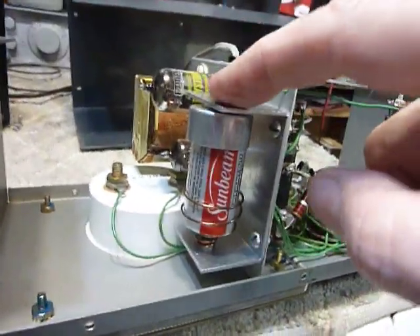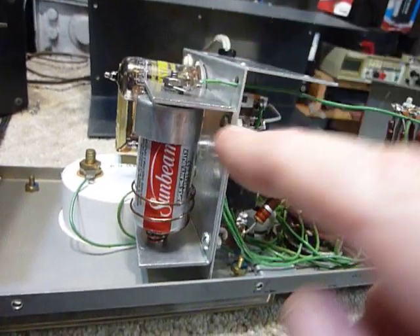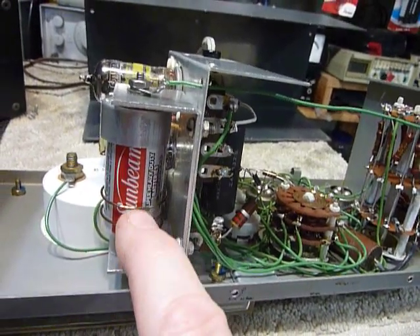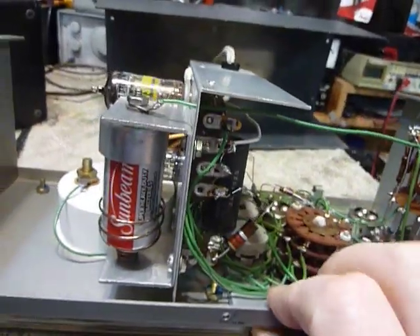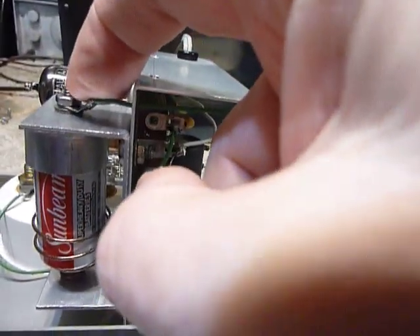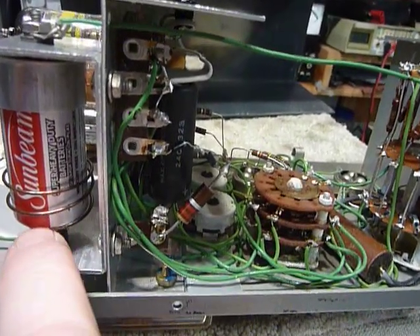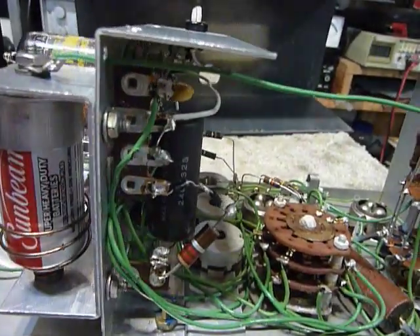One problem you often run into with these is the battery hardware — there's a nut, bolt, and bracket that bolts to ground, plus a spring connector on the battery. These get corroded and make poor contact. I got it working with the battery as original. I took it all apart, cleaned everything, put in a nice new stainless steel bolt, and applied dielectric silicone grease to prevent future corrosion. I scraped the spring clean with a sharp penknife where it contacts the battery, applied silicone grease there too, and put in a new battery.